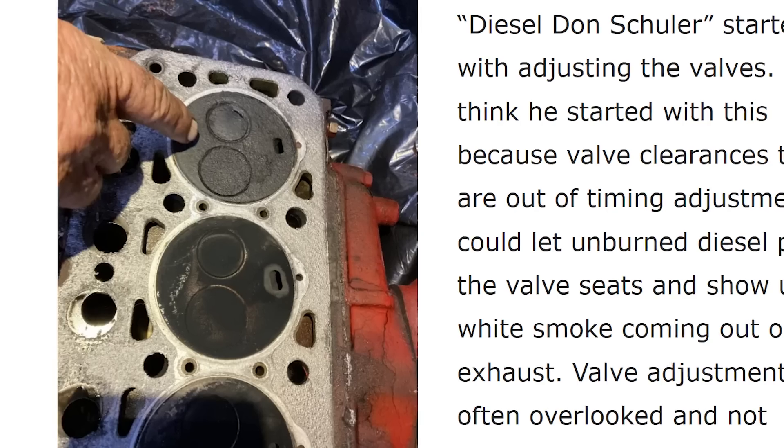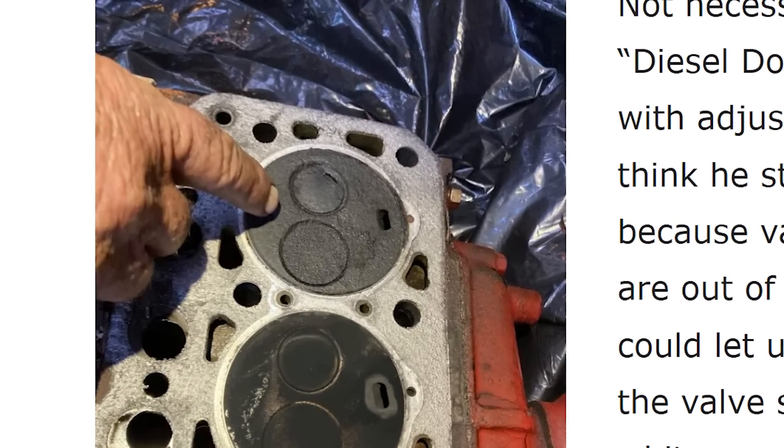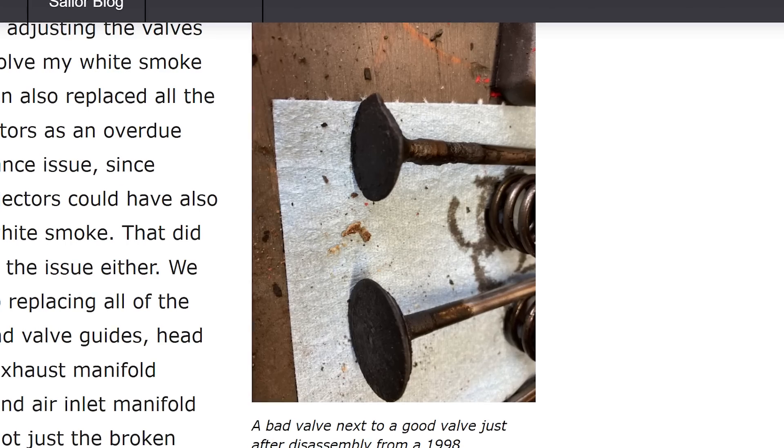If a weak cylinder is flanked by healthy cylinders, the problem is either valve-related or head gasket-related. In one case, cylinders 1 to 3 read about 400 psi and cylinder 4 read zero, which led to the discovery of a broken valve after removing the cylinder head. Low pressure readings could also result from a blown head gasket, piston blow-by, dry cylinder walls, or valve blow-by caused by worn cylinders or piston rings — which should also cause white smoke in the exhaust. Also look for incorrect valve clearances or sticking valves. Abnormally high readings on all cylinders indicate heavy carbon accumulations.